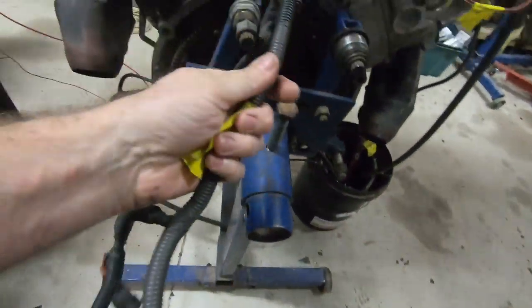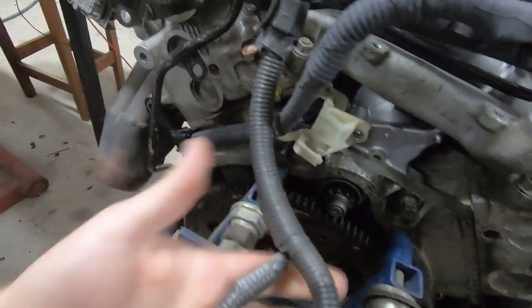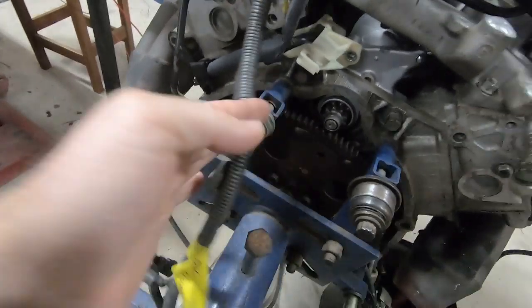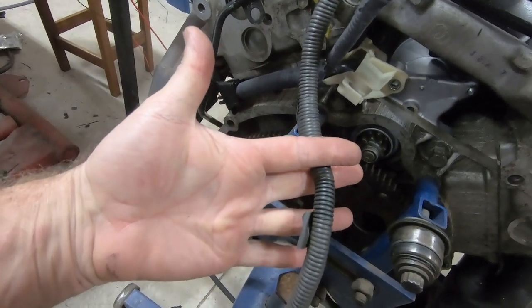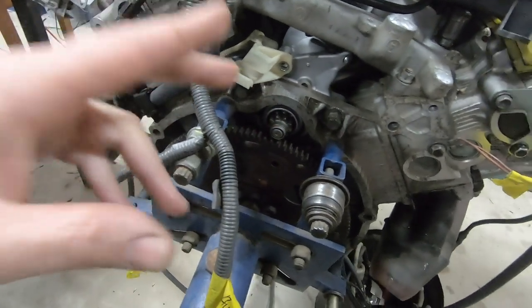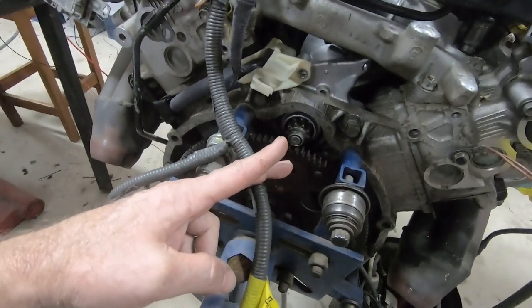This particular job's going to be a manual, so we're going to pop the transmission loom out of it. This loom here is leaving. We won't take that one. That's the oxygen sensor. We'll skip that. So past there, it's all coming out of it. And I will be putting in a couple of wires for reverse lights.